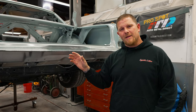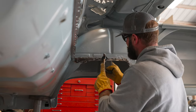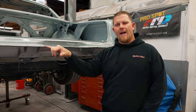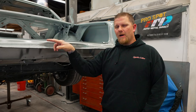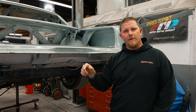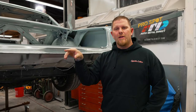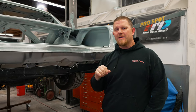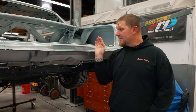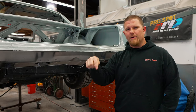A cool thing about a strip disc is it's not removing material. I like to go through and clean all the rust off with the roll lock strip disc, then come back and hammer all your edges. If you have an edge that is wonky and wavy, you can come back with a flat toe dolly and a hammer and work it back flat. We talked early on about planning which side of the weld is going to be needed. For the back of the car, we chose to have the plug weld at the top because it's easier to weld and grind. In the wheel well, we drilled all the way through for a vertical weld. Make sure you pop holes in the trunk pan where needed — for example, on the sides next to the quarter panels, we put holes there so when the trunk pan goes in you can clamp the two together and weld right up.